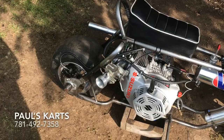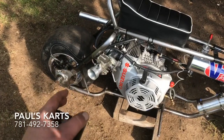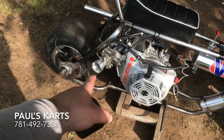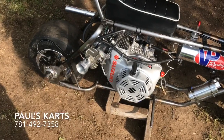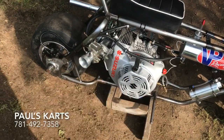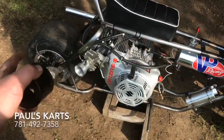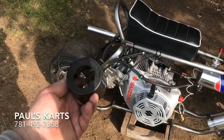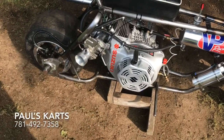No restrictor. Here's the funny part — same thing when it felt like it was riding better versus when it's wide open like this: when it's open like this, I was getting 10 miles per hour more and it was running poor. So imagine fixing that fuel delivery problem. What you want is the most amount of air while being able to keep up with the fuel flow. That's how you really solve the problem. Restrictor plates — yeah, they'll work, they'll get you there, but why not just get the right amount of fuel in there?